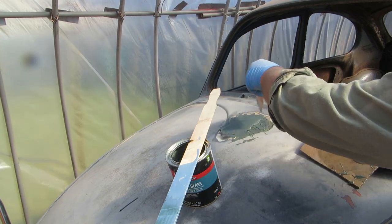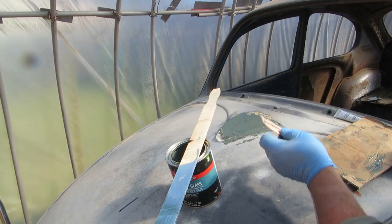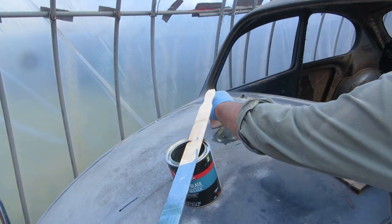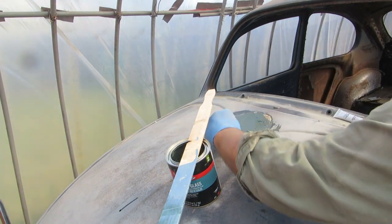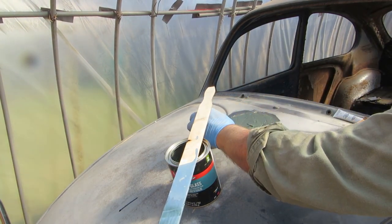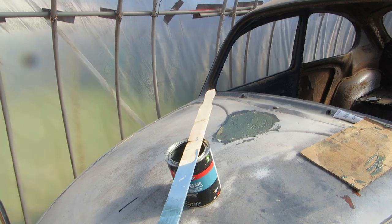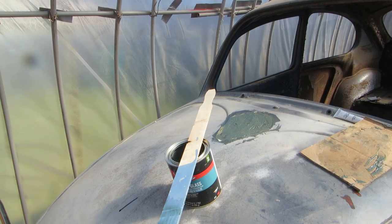Now, does that need to be right up to the top? No. Because it's hard to work fiberglass, so you want a top coat of Bondo. But for structure, you want fiberglass. Now, we'll lightly grade that when it sits up with a cheese grater, and then we'll put a coat over the top. A coat over the top is only going to be about an eighth of an inch, so you're not dependent on real thick mud for your support, because you'll get cracks if you do.